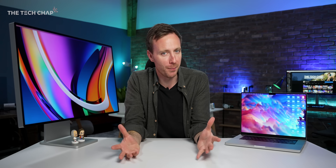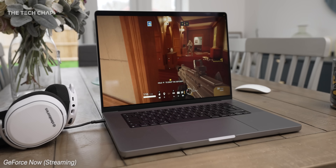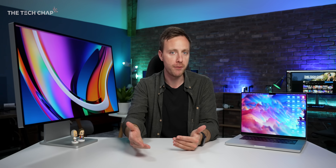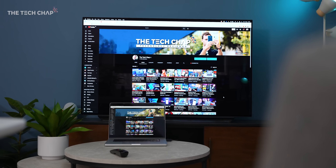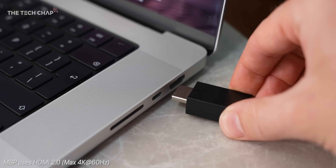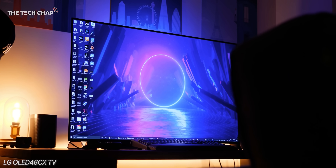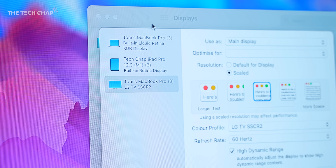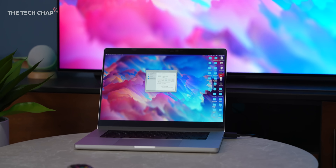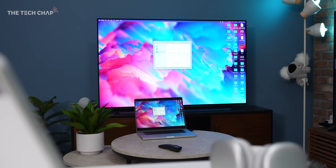For gaming, this probably isn't your number one priority if you have a Mac. You've got Apple Arcade, some Steam titles, and cloud gaming via GeForce Now or Xbox Cloud Gaming, but most people don't play many games on Mac. If you are gaming, all these monitors will work, but for the best experience you want 144Hz or above. As for using a TV as an external screen: TVs use HDMI inputs, so connect via HDMI or a USB-C to HDMI adapter. TVs are a cheaper route to bigger sizes, but they take up desk space and sitting close can make it hard to see everything. Older 1080p TVs will look soft up close, and slower pixel response times can make motion blurrier than a regular monitor. If you're sitting at a distance with a long cable, the extra size could be useful.